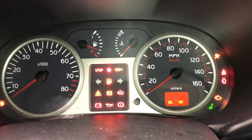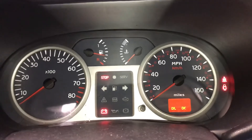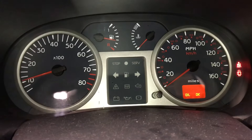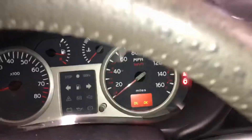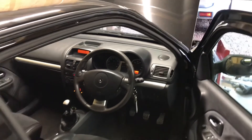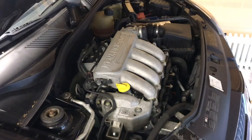Fingers crossed — here we go. If this engine management light comes on, I'm going to scream. It's out of gear — three, two, one, here we go. Well, there's no engine light at the moment, which is good, and it already sounds good at idle. So hopefully that's it fixed — fuel injectors. All four changed, and I can say now there's no lumpy idle, it's running sweet as a bell — fantastic news! Just two bolts to put that on, four bolts to put that on, and we're all good to go.